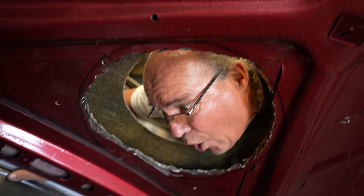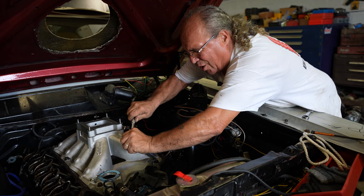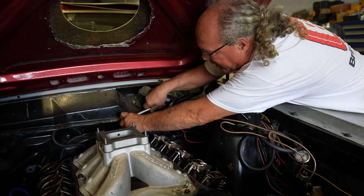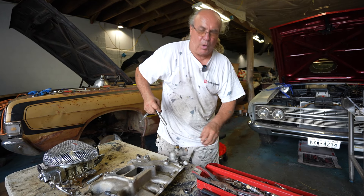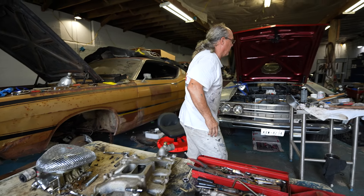That's a big hole. When you're torquing these down you only go 30, 30, 30, 30 ft-lbs — perfect. We're at the racetrack; she runs hot. You do want it to warm up though — you want it to get up to temperature before you go down the track. What do you guys think about running a thermostat at the track — should we run it or should we leave it out?